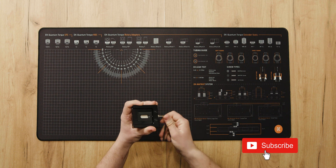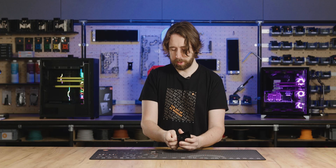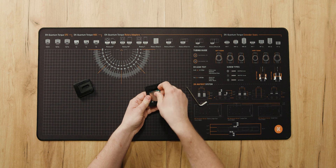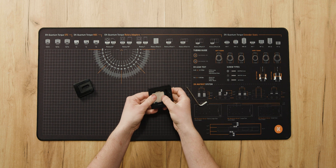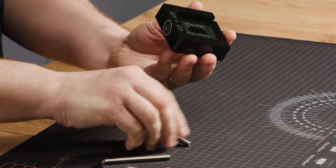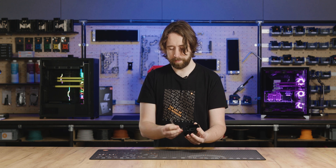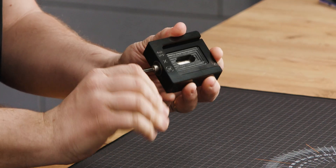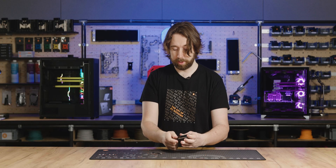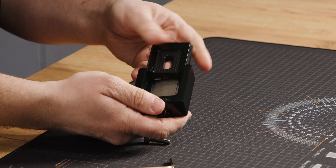This is much easier than the first time. I'm going to repeat the first step again — the CPU goes back into position one, so the slider will also be position one up again. If at any point the screw becomes tighter, watch out that you haven't cross-threaded it during the process. You shouldn't need an allen key until it's actually moving the slider. Now back to triangle position two, slider in position two.